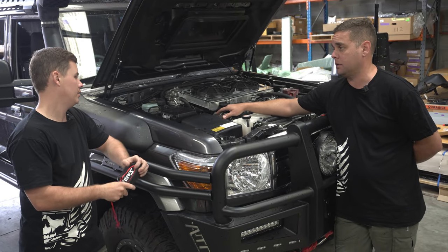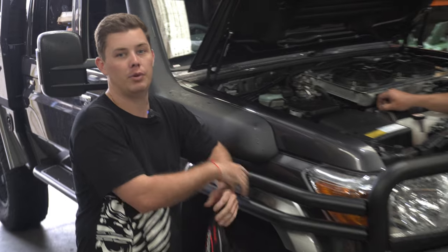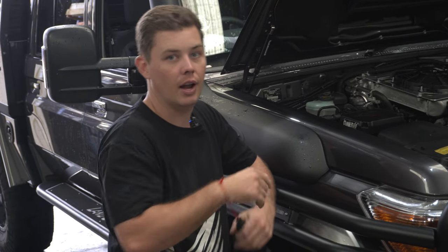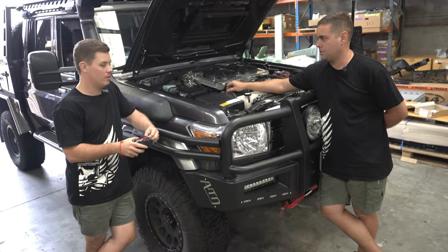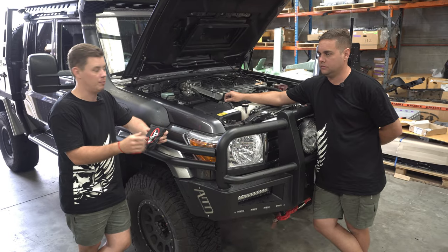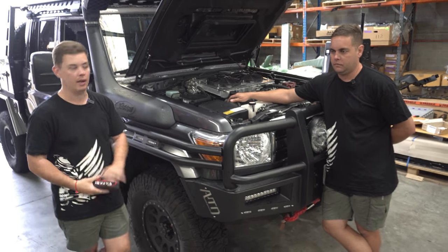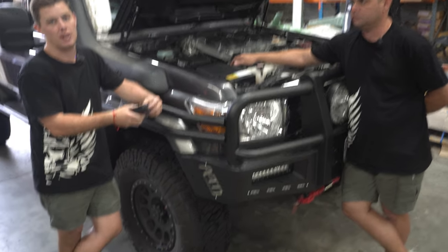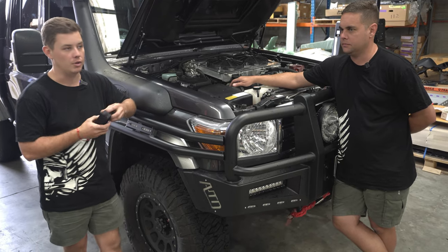The turbo — it's technically a little bit bigger and designed to handle the boost, which will sit at about 20 to 22 psi. It is technically a Garrett turbo, and it's a nice pretty red one, hiding up underneath there. Because you've got a bigger turbo, you'll have that little bit of lag down low, but you'll be making full boost around 1,800 to 2,000 RPM. Once the boost comes in, it basically pulls all the way to redline — constant power all the way there. These things sitting at 100 km/h, even with 35s, you're around that 2,000 RPM, so it's sitting right on boost. If you need an overtake or you're coming uphill, just put your foot into it and off she goes.